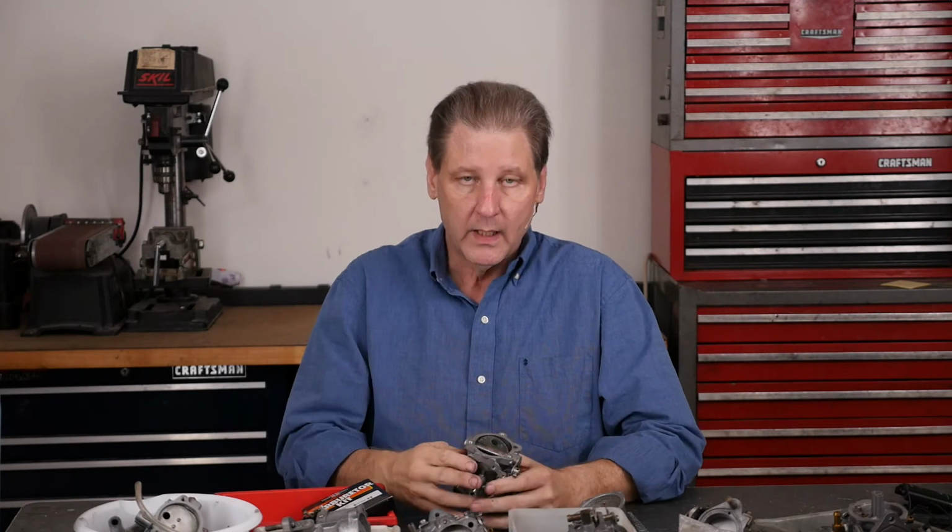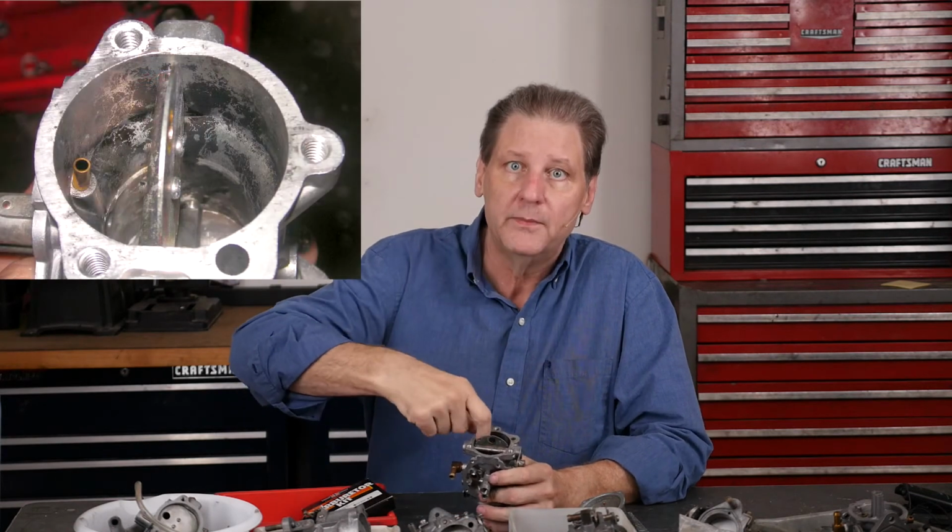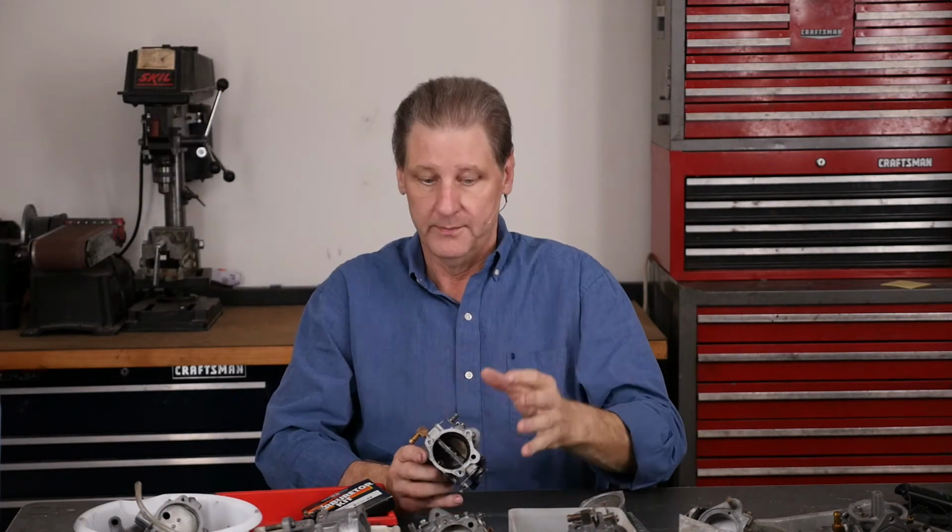It didn't for this. Then the other failure in the ultrasonic, 100 minutes total, I had a heater on it. It got up to about 45 degrees centigrade on the first 50-minute session, and it got up to 54 degrees by the second session. So I'll put pictures up. Carbon everywhere. And the ultrasonic has trouble with the carbon. It's not hard enough or whatever, so the carbon didn't come out of the throat. Okay, we can solve that.